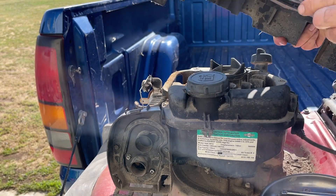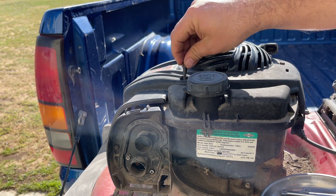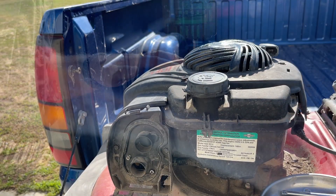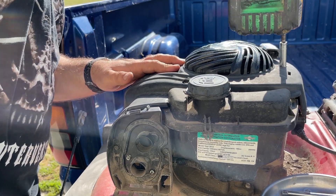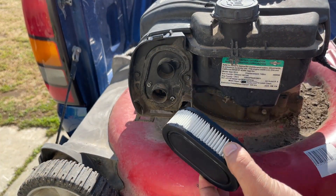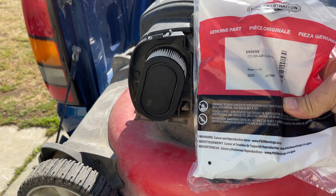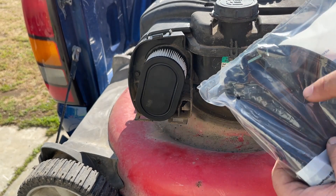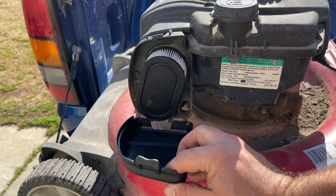You can reinstall the recoil. Put the 5/16th bolts back in. Before I put the new oil in, we'll install the new air filter. Here's the new air filter — links for all the parts are in the description. It goes on just like that. An OEM Briggs filter box cover — make sure you buy the correct one for your machine. This one does not have the primer on it, so it does not have the hole in the air box.